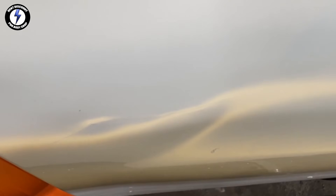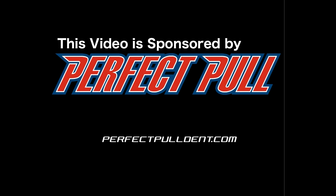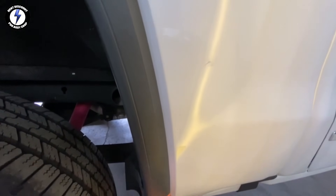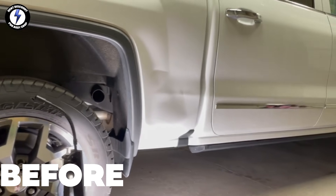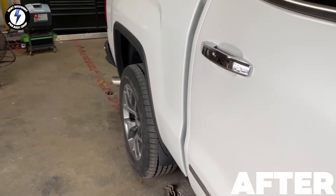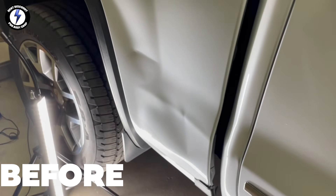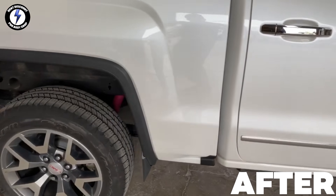I'm switching sides, going back and forth with some knockdown work — using a leather tip aluminum knockdown along with precision blending with two hammers. We are now in the final stages. With the tool tip, I'm removing the remaining crease. Like magic, the dent is disappearing. Before I show you the final results, I want to thank Perfect Pull for helping me in this repair. Here is the finished product. Thank you for coming along with me on this bedside pulling. Are you wanting to learn how to use less filler on your repairs? You might need my channel on your next dent. Like, comment, and subscribe — I will see you in my next free video.